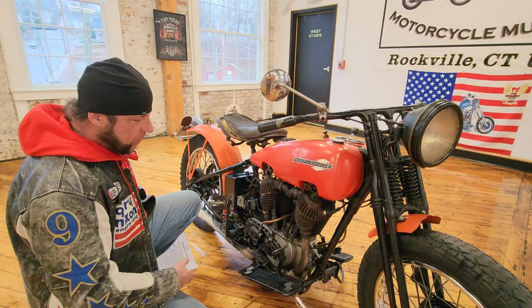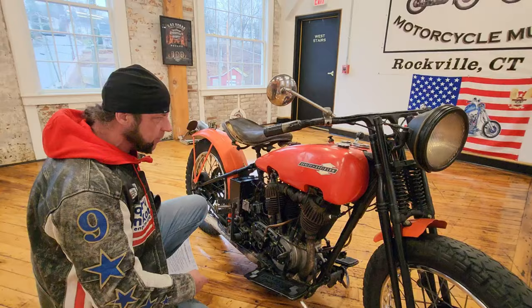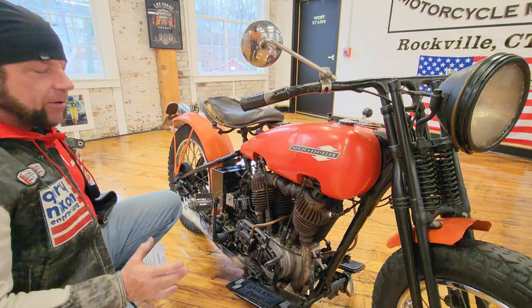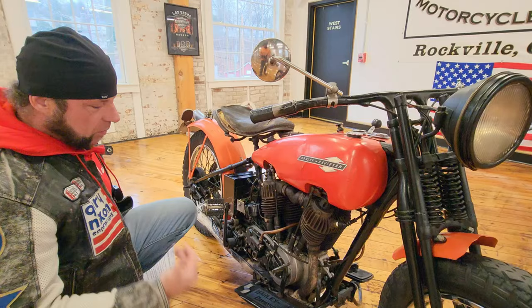These are a total loss oil system. When they came out with the knucklehead it had a proper recirculating oil system, but on this one there's a pump here — when you're going up a hill you're supposed to pump it to put more oil in. It actually uses the oil and spills a little bit on the road. They say it uses about a quart every 500 miles. You have an oil tank and a fuel tank, and it's called a total loss system.